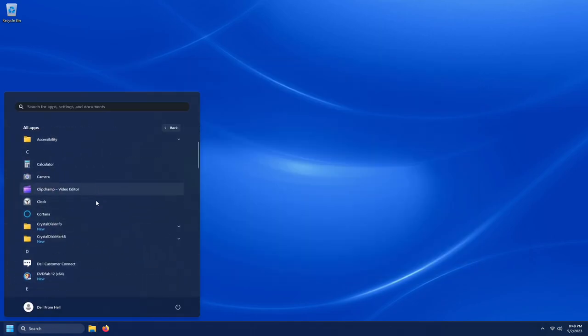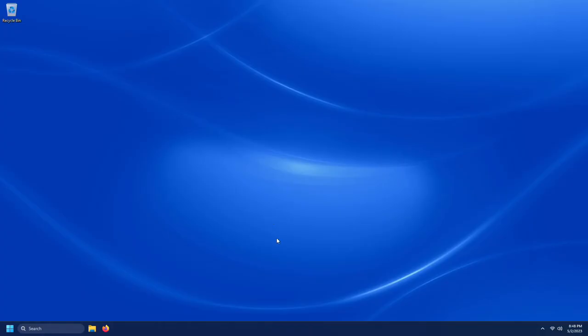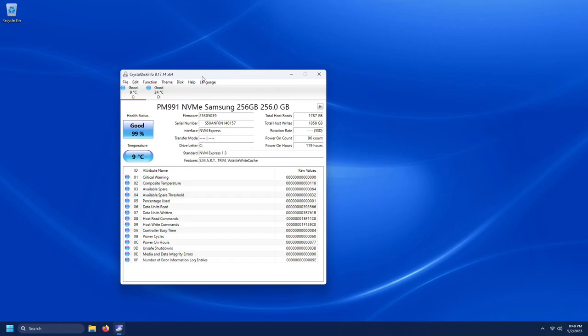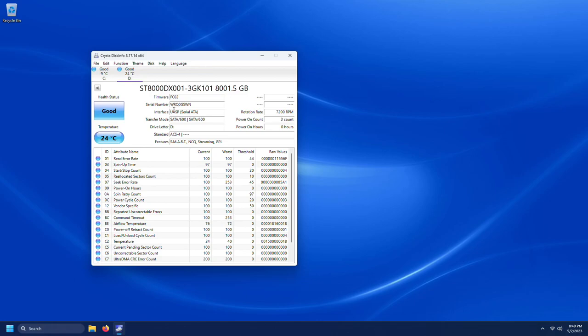I very nearly forgot what I said I'd show you. The dock is transparent to utilities like CrystalDisk. So if you ever want to do a firmware update or check the condition of your drive, you can do that — it doesn't show up as some weird USB dock. Right there is our eight-terabyte drive. You can see it's got zero power-on hours because we just initialized it, and it's been powered up three times which makes sense as I was looking for the right one to use. You can get your serial number from it and all that.